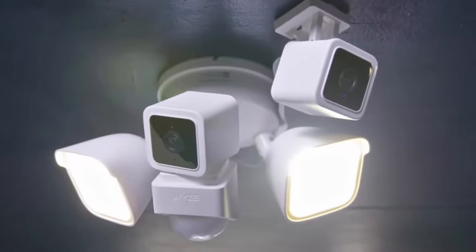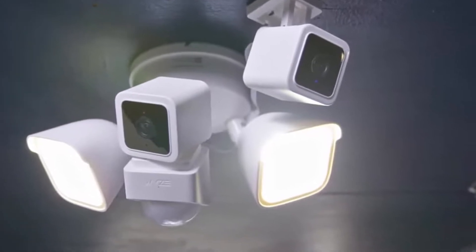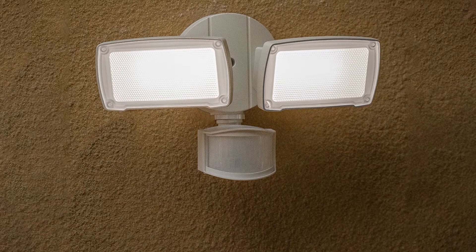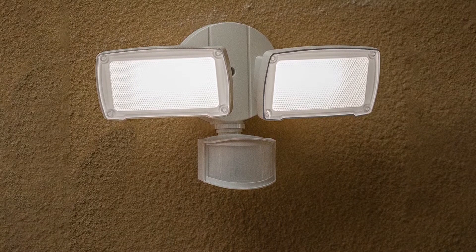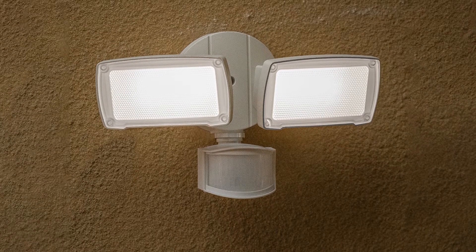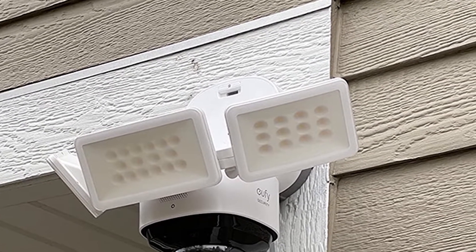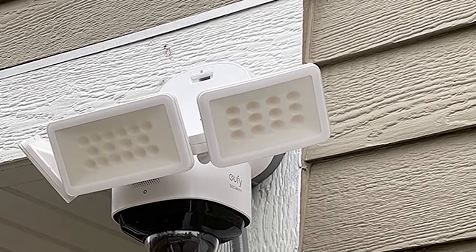Make sure your Wi-Fi router is turned on. The camera may not have power — make sure the wall switch and breaker are in the on position. Cycle the power off and on; you will hear an audible tone and the status LED should blink red, then turn to a solid blue in about one minute.